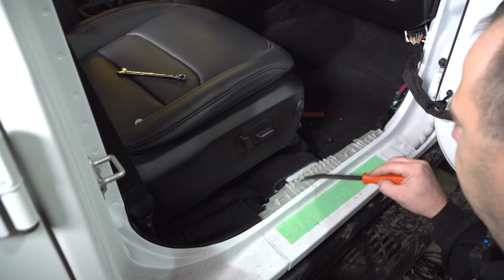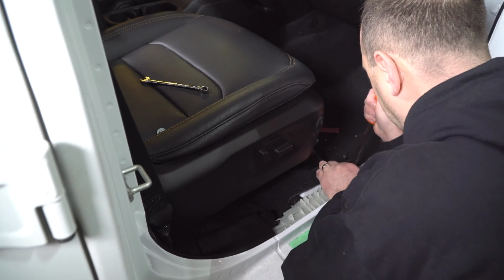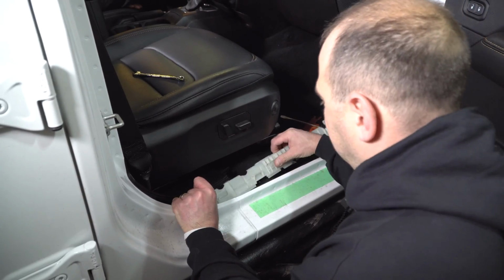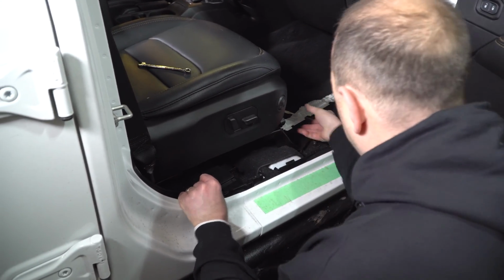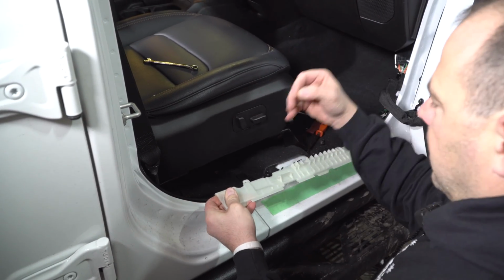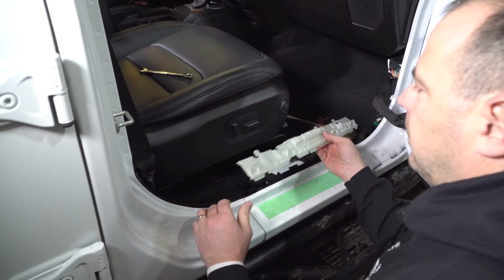So the next thing you want to do is take this plastic cover off. There are these black tabs. If you just kind of loosen them a little bit. So you want to remove this panel. I'm not gonna lie, it's a little challenging. You've got some tabs here and here, along the way, 1, 2, 3, 4, 5 of them. You kind of want to pry it out with a screwdriver. This will come up this way into the vehicle.